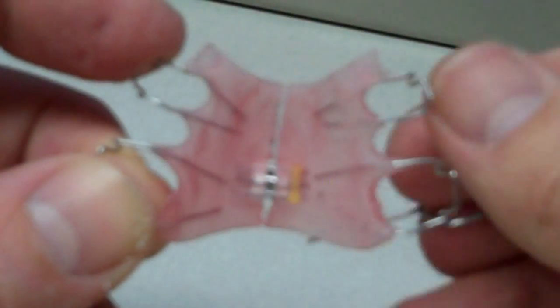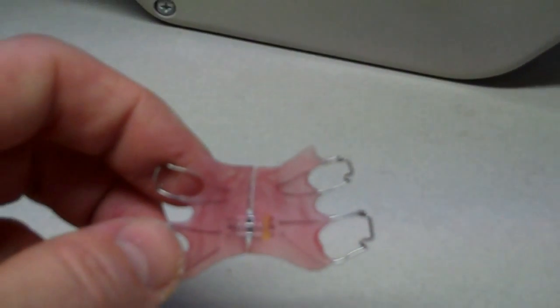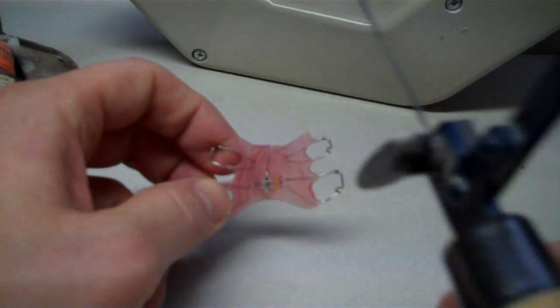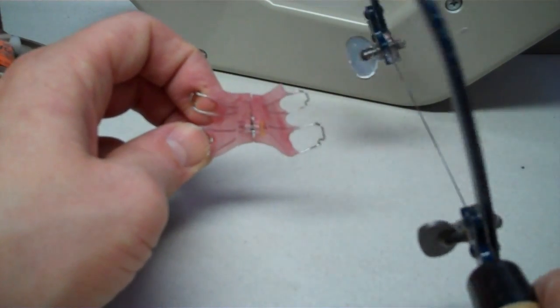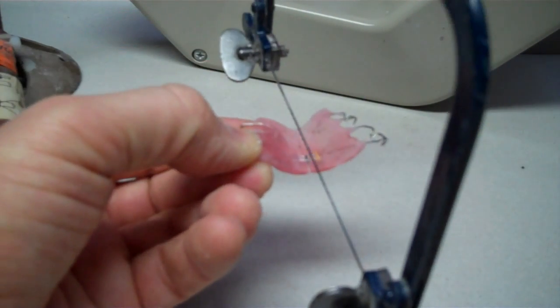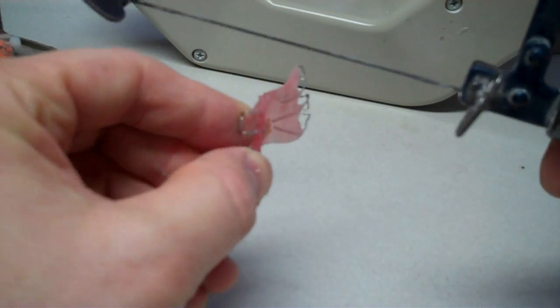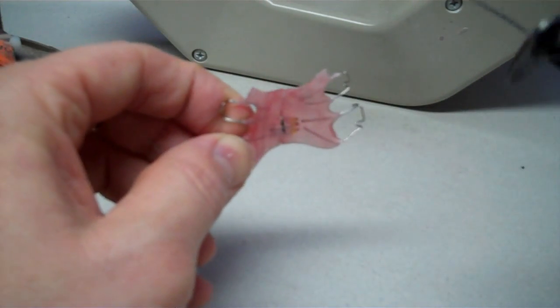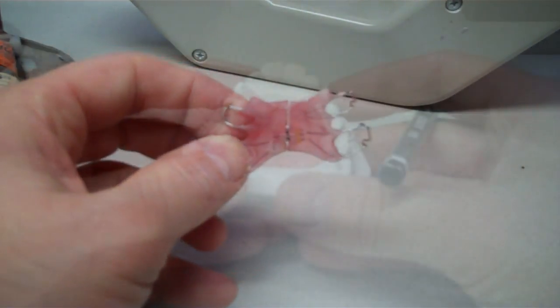with no wiggly lines. What some people tend to do or try to do is to cut it from the vertical surface, so they cut it like this, but what happens is the saw ends up going all the way down in a wiggly line. So if you cut it as flat as you can, you go through the thinnest part in one section rather than trying to cut through a whole length of the appliance. So we cut it through that way rather than cutting through that way.